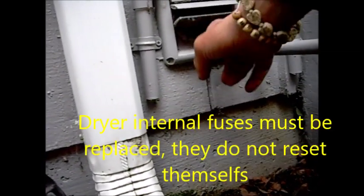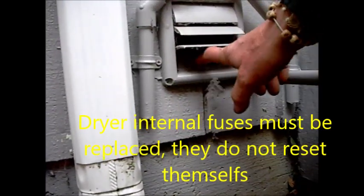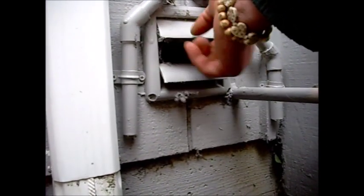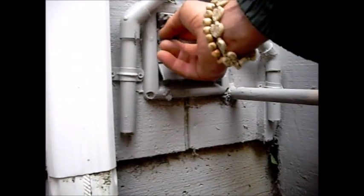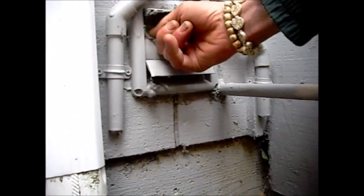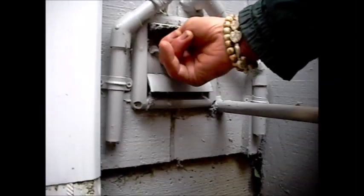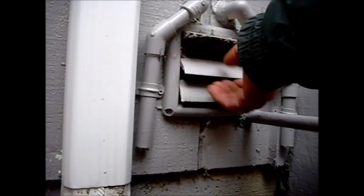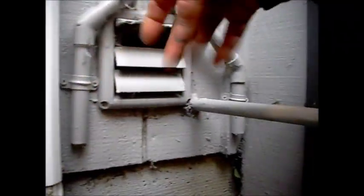There's stuff in front of the vent. Like I said, probably around 70% of the dryer repairs I go to are related to flow — people put stuff in front of this and it will kill the internal thermo fuse on the unit. If this thing is backed up... who replaced it? Well, they didn't do a very good job. The flow is a little bit restricted, I can tell. Let's go back inside.